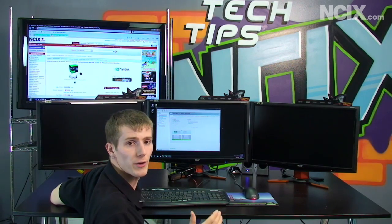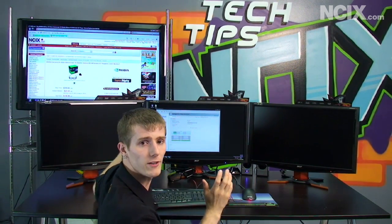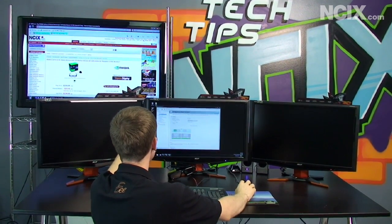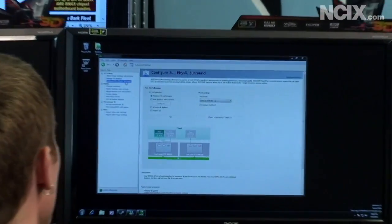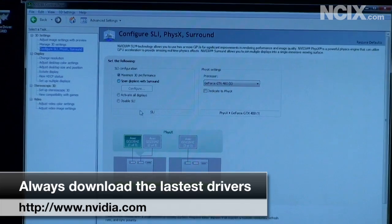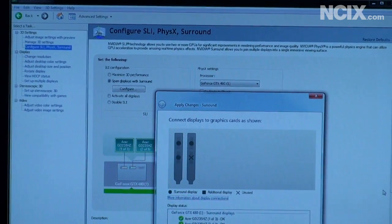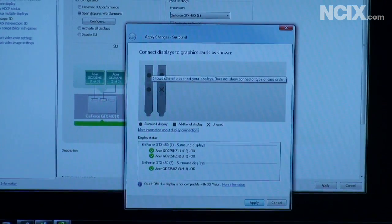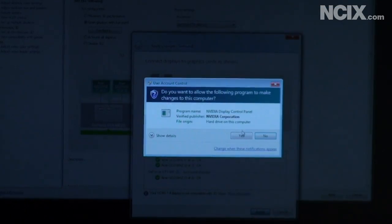Once you've configured the hardware side of your SLI-ready gaming machine, you will need to do a little bit of software configuration to get NVIDIA Surround going. The first thing we'll do is go into Configure SLI, Physics, and Surround — that's there in the new driver menu. Then it's as simple as clicking Span Displays with Surround. It's really that easy. You click Apply and just confirm that you've connected the displays properly, then click Apply again.